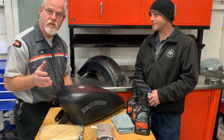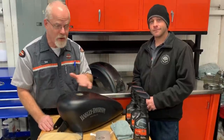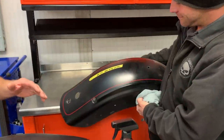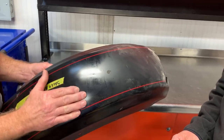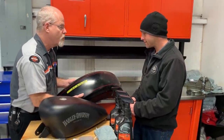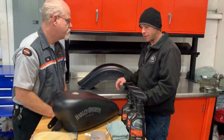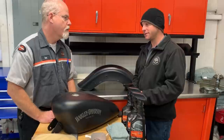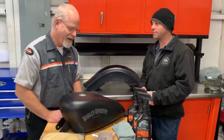I hope we've answered some questions on how to take care of your denim. There's no wax to finish it off, but you want to keep it clean. Don't overly rub — the more you rub, the more you can scratch it and turn it into a satin finish. We have an example here: someone had a seat that kept rubbing the denim, and now we have a satin patch. That's the extreme of what can happen. If you try to use a wax from another manufacturer, it'll make the denim a little darker and over time the wax will clog up into the porous paint, leaving a haze. Just stay away from it and keep it clean.